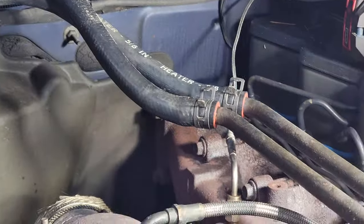Another thing to note from the installation manual: it recommends drawing coolant from one side of the block and returning it to the other side for even distribution of heating across the block. In this case it's not perfect — the feed is at the front and the return is at the bottom near the water pump area. Ideally you could take a feed from the back driver's side where the factory coolant temp sensor is, tee off that, and figure out plumbing on this side for the return.